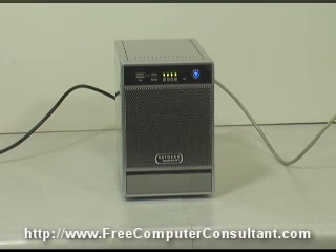Now this unit is set up — currently it's just plugged into a power source, we have it plugged into a UPS, and it is plugged into the PC with a standard Category 5e cable. It does work with either a straight cable or a crossover cable. You don't need any hub or switch, just plug the PC into it.